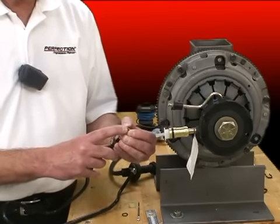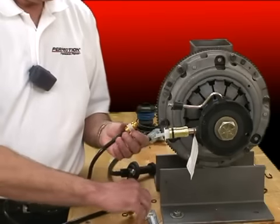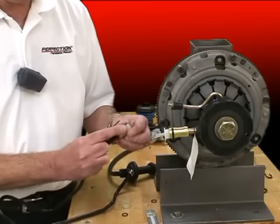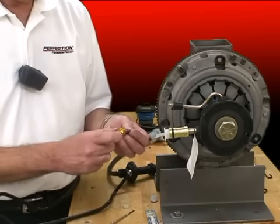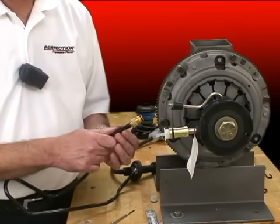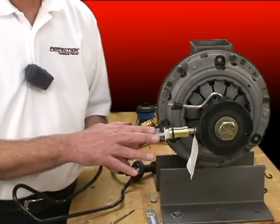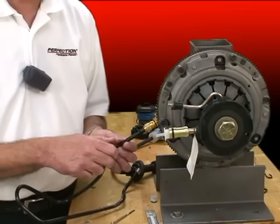Going to pinch the O-ring, and push the old O-ring off. Sometimes it helps to put a screwdriver underneath the sleeve and push that off. There's our new O-ring. We'll put that on, and the new sleeve. So we're all set there. Now, we supplied this with this protective shipping plug in place. Hopefully it stayed in place the whole time you were installing the transmission.